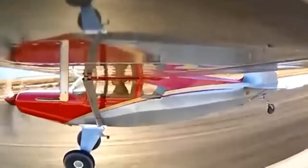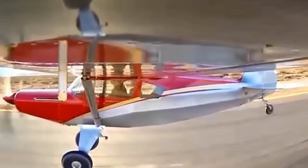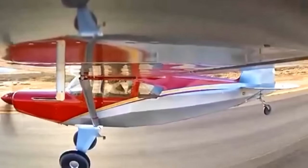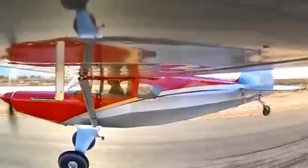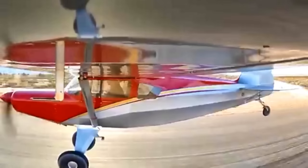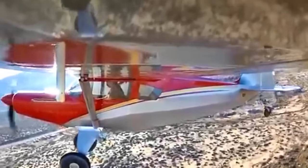I needed to make some of the fuselage tubing a little bit thinner wall and smaller in diameter in some areas, but it's still pretty standard-sized tubing — three-quarter-inch and similar. The wing had a lighter spar because the plane is rated at 1,500 pounds gross, or registered at 1,320. So it's capable of 1,500 if it's not being flown in the sport pilot class. While it's an LSA, it's actually an experimental amateur-built available for someone to fly with a sport pilot certificate.